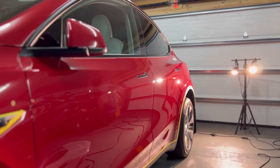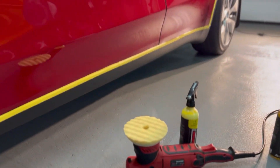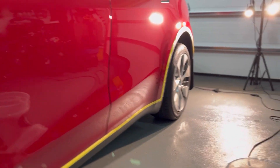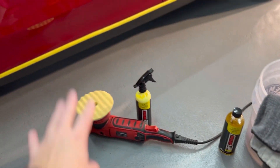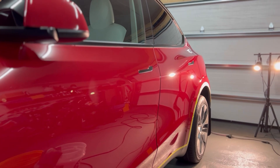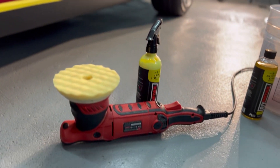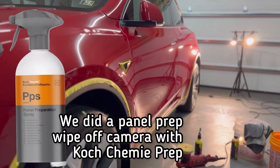We are finally all done with polishing this beautiful Tesla Model Y — paint turned out fantastic using our DIY Detail Gold Standard. We only had one pad for this entire vehicle, and we were able to use our DIY Detail rinseless wash in two buckets — one to clean our pad in between panels, spin it dry, and prime it, and then after polishing, to wipe off all of our polish residue safely. We did two or three quick passes in about an hour and twenty minutes to polish this entire vehicle, and now we're ready to go ahead and apply our coating.